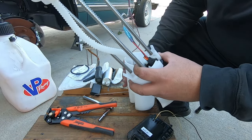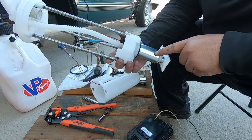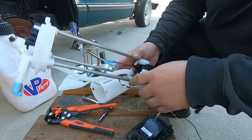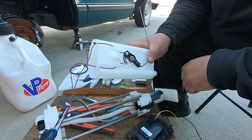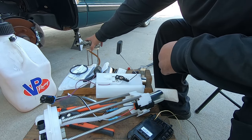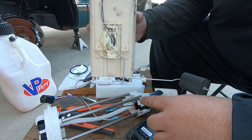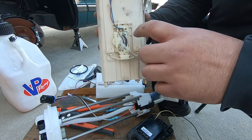I've been out here most of the day trying to figure this out. I was able to adapt the stock sending unit with the new Walbro pump, safe for E85, but I had to do a few things. One - modify the rubber grommet that it accepts, just cut it a little bit. This one ended up being a little bit shorter and it wouldn't accept it inside of the hat. You only need the hat because it has a new sending unit - this gives you your gas gauge, which I definitely wanted. This is how it reads your gas gauge with the floater. When it's empty this would be E, and as the fuel level goes up it starts getting to quarter, half, and then obviously full tank when the floater's all the way to the top.